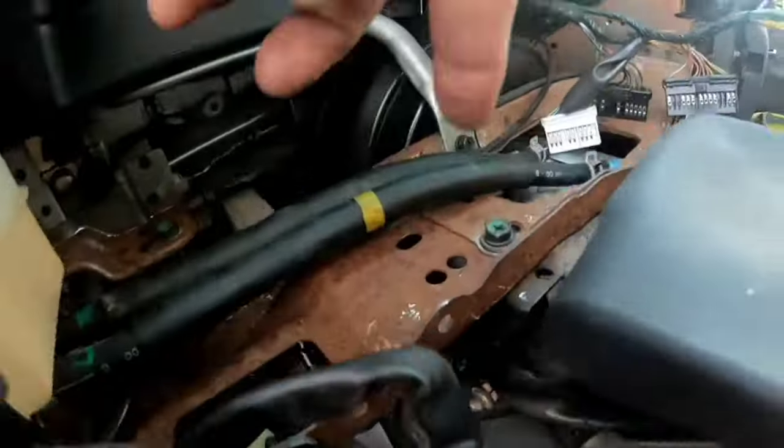Here is my new brake booster — the old one is still in there. Let's compare to make sure it's the same thing. We have four rectangular studs — they're not on a square; these are farther than these — and at the five o'clock position we have a little pipe, which matches. Turning it around: four studs front and back, and the place where the bracket bolts into it. Looks the same. Let's change it up.